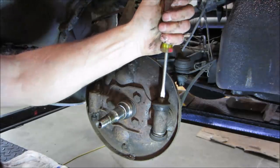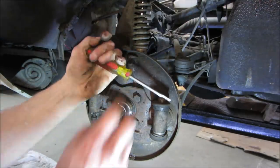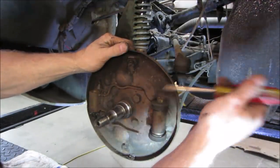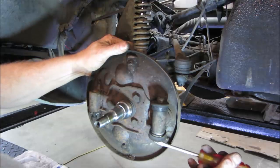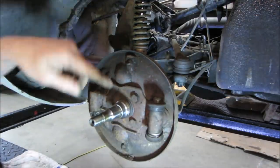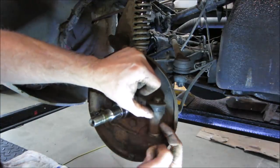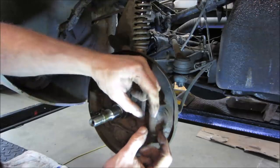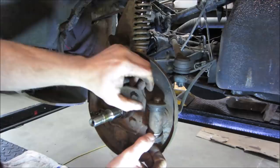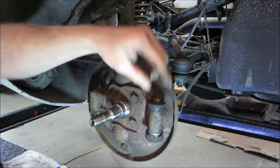First, to see if these will turn. No, they're locked up solid. So this is the wheel cylinder, and what happens is hydraulic fluid comes from the master cylinder when you push the master cylinder. Inside here, there's a machined surface with a spring in the middle, a hole in the center where the fluid comes in, two cups that are like rubber, and then two metal caps, which are these on the outside. See if we can get one of them out.